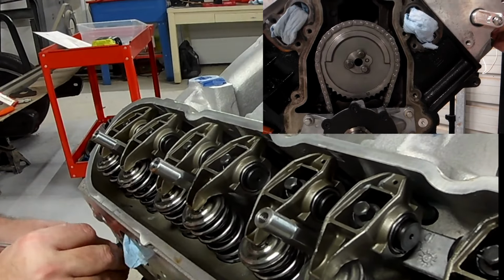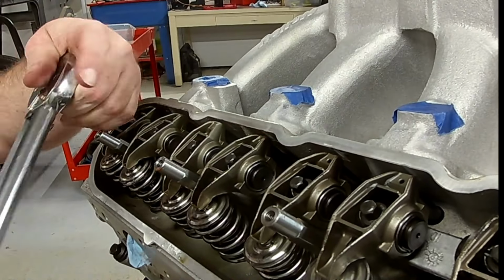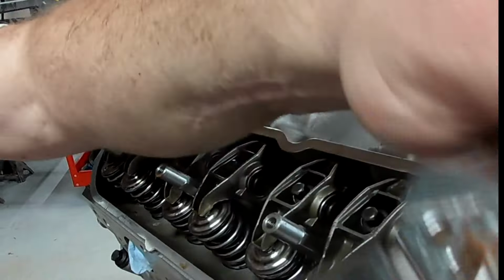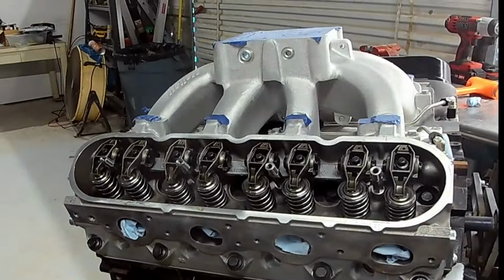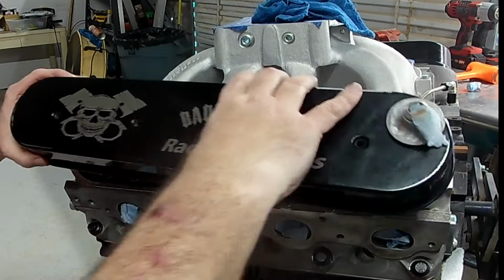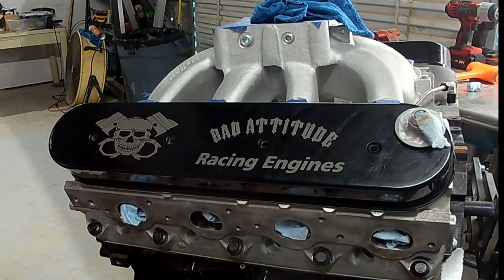So I'm going to rotate this engine back around and line my dots up at the 12 and 6, how they're recommended when you put the engine together. I'm going to double check the torque on my rocker arms and put my valve covers back on. I still need to find a bigger torque wrench so I can torque my balancer bolt down. I'm going to wrap this up because it's already been a long video, and we'll finish putting the cover and installing the balancer in the next video.